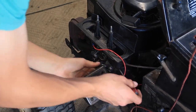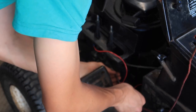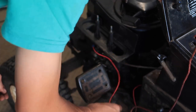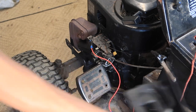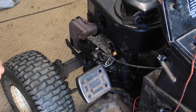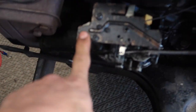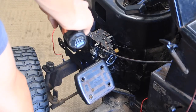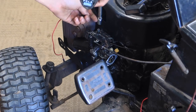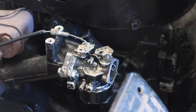Taking the air filter body off — there's just two screws on the back here. Undo those, pull it out — it's a bit hard to get into this one — and then the air filter should just pop off like that. This is the carby, this is the governor assembly there. What we're going to do is take that off and make a bracket to hook onto the throttle. On top of the governor are two 8mm bolts; they unscrew and then the whole governor assembly comes off.